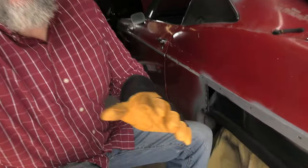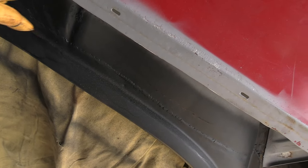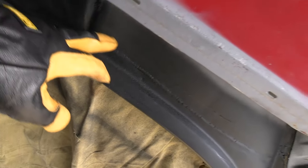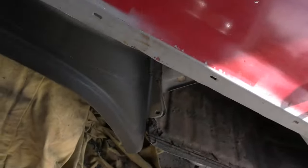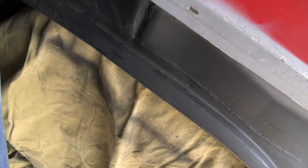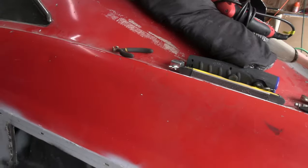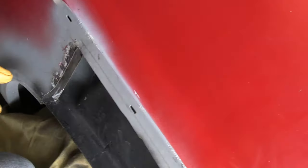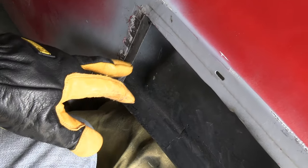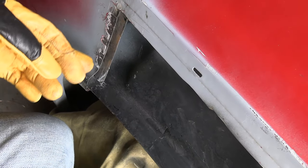So far what I've done on this car — let me get my camera around here, pardon the shakes. When I bought this car, the rear quarter panels had been cut out, the passenger side wheel housing had been cut out, but the driver's side was all crunched up. So I sectioned out where it started getting bad and replaced that outer wheel housing.